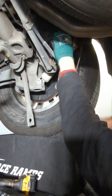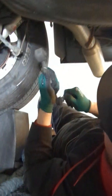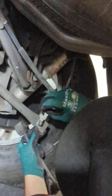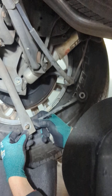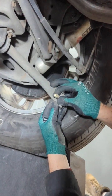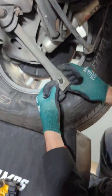Let me pop this off. Let's see. Looks all right. Real loose here, real loose. This one looks straight, the other one was bent. Oh yeah, and the bolts. See, even the factory has a lot of play, but this is the one that, like I tell people, they include these other ones for the sway bar. Look at that. Even the factory, when you put it in there, look at the play it has. Whereas that bolt, I was showing you guys my grade 8. Look at that. Solid. Barely any, but now you have this much. See there's that much versus, look at that. Junk.